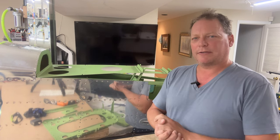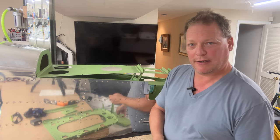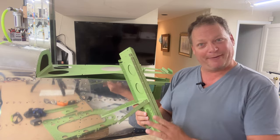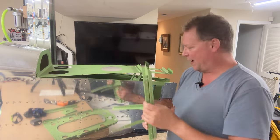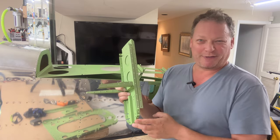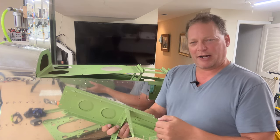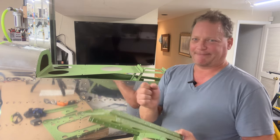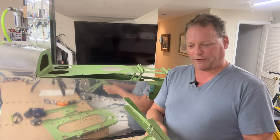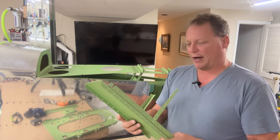Well, that did not go terribly bad, although it didn't go as planned. This took about three hours to get the tail torn apart. The pair of 12s on the back came out pretty easy. I did a great job of drilling out the rivets on the flat face of the skin, but once I got to the rounded corners, I expanded a few of the skin holes. I know — stay perpendicular to the face of the rivet — but lining that up against the curved surface wasn't easy. So I've got a few oops rivets to mark out and I'll have to upsize from threes to fours when I put in the replacement parts. But other than that, I think it came out pretty well.